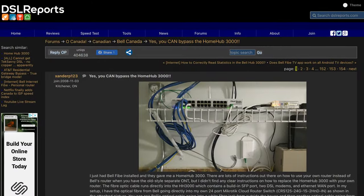For those who want to forgo Bell's equipment entirely, the only option I'm aware of is the Bell Home Hub 3000, which has a removable SFP module with the fiber cable. You'd remove that and plug it into an enterprise-grade switch that can lock to 2.5 gigabit — a 10-gigabit switch won't work. Also worth noting: the SFP+ port on the ASUS AX89X will not lock to 2.5 gigabit, so using the Home Hub 3000 SFP module directly into this router is not an option.